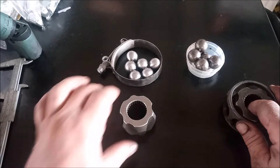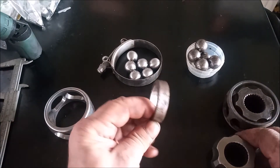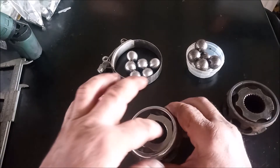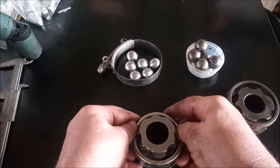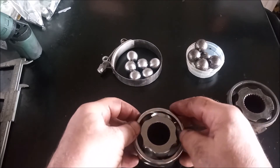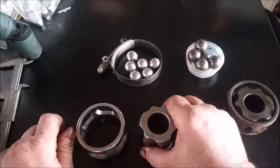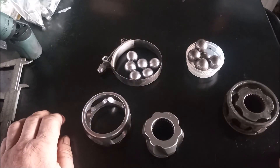With the ATS joint, it was a lot harder. I had to use a trick: I took a small spacer from my tool drawer, set the balls in the cage, and set the inner race on top of the spacer. That gave me enough maneuvering room and extra angle to manually assemble the CV joint. Those are the main differences I see — people who know what these differences mean are welcome to comment.